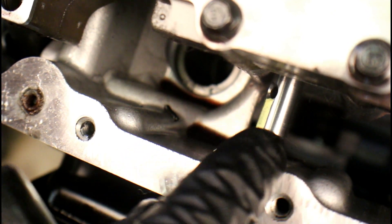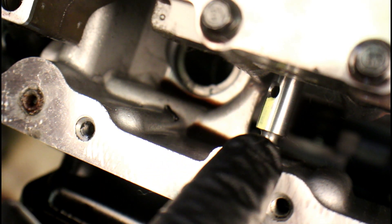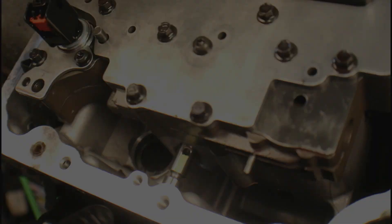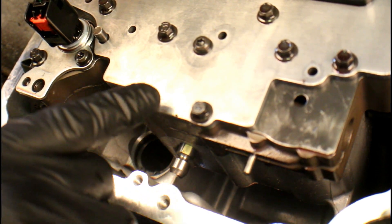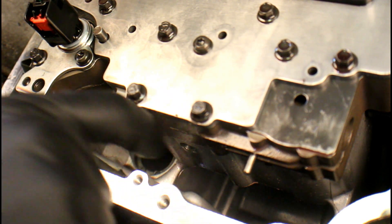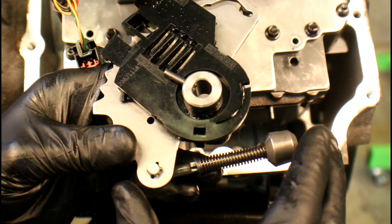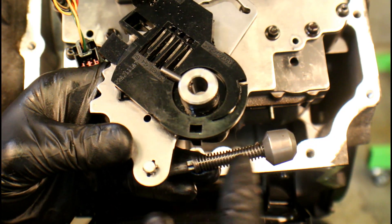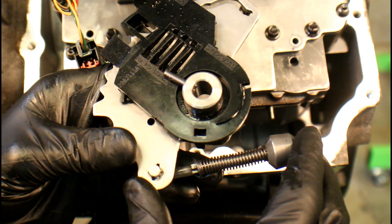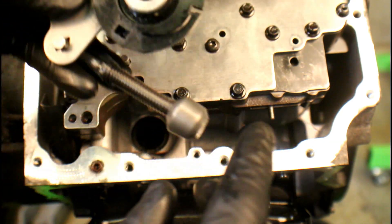Now I've got something that will actually protrude below the range sensor to give me an idea of where that hole is going to be for the roll pin to line up with. At this point we can pick up on the selector shaft and make sure we get plenty of room to sit the range sensor down in there. Now we've got that replacement range sensor ready to be installed. As you can see, the parking linkage is in place as well as the roll pin has been pre-installed.